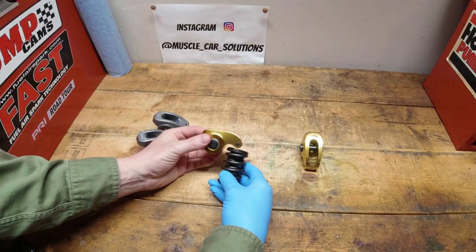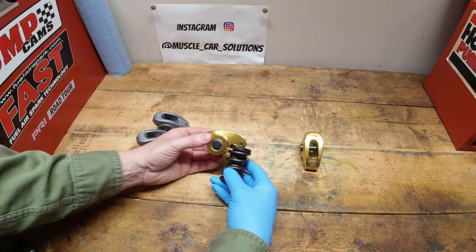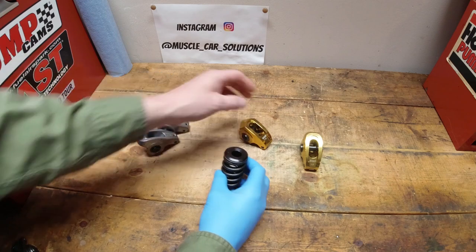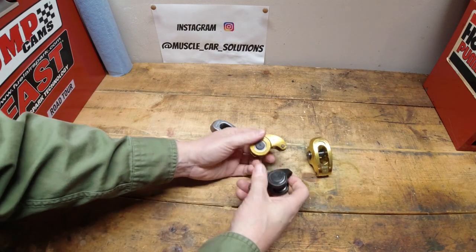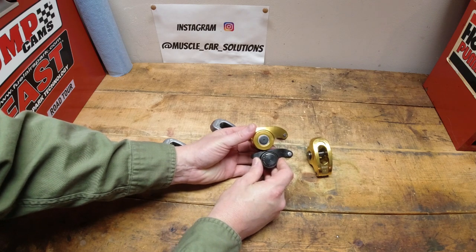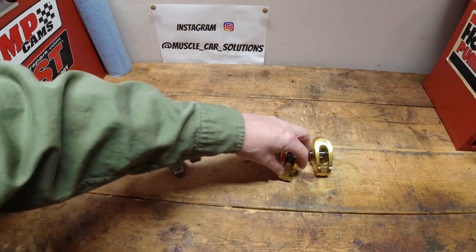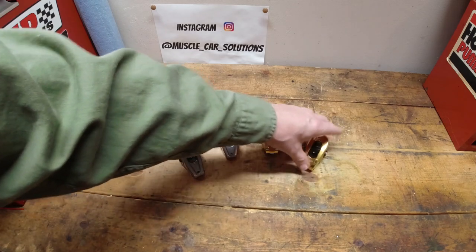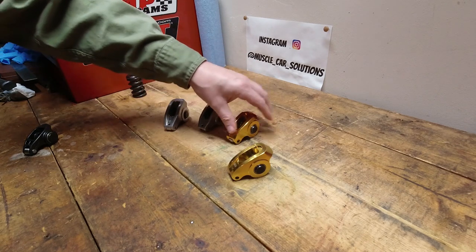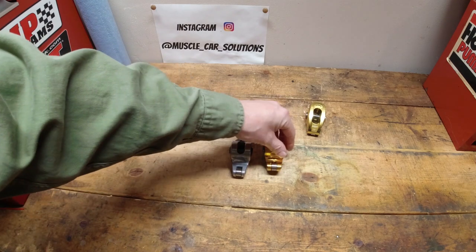The Ultra Gold aluminum rocker has 700 on the seat pressure, and the max lift has a range from about 550 or 600 all the way up to 700. Max RPM bumps up to 7,000 on these. They're CNC machined rocker arms, so their tolerances are much tighter and better. They've got that nice arch design, really good strength, and a superior oiling system. If you're going to choose an aluminum bodied rocker arm, the Ultra Gold is certainly the way to go if it fits your cam specs. The Ultra Gold is far superior to the old style die cast aluminum rocker arm.